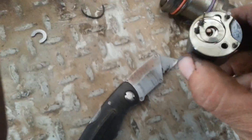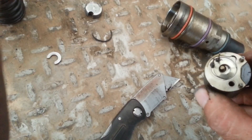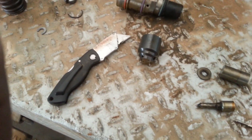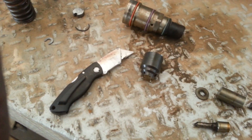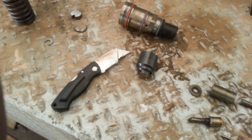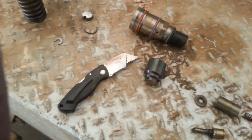From here, it pops the valves underneath there to lift it up off the seat. It takes six volts, 10 amps to fire the injector — that was back when on the 149s, and I'm pretty sure this is about the same way. Six volts, 10 amps to fire the injector, or to lift the plunger — I mean, lift the poppet valve off its seat.